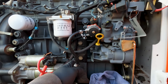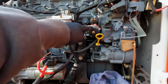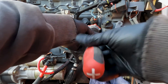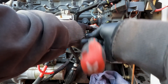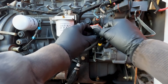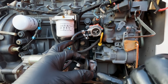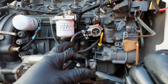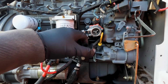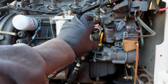If we follow this fuel line, you'll notice the fuel line coming from the primer bulb is coming straight from the tank through the primer bulb. The first place it goes is into our lift pump, and then out of the lift pump it comes around and into our fuel filter. In the center of this lift pump — or primer pump, whatever you want to call it — there's a little screw we can pop out. Right under this cap you'll notice a fine mesh screen. The fuel comes straight from the tank and has to pass through this screen first, so this is your first filter. Any trash or debris in the tank is going to clog this up before it ever gets to your fuel filter. So if you're having a fuel problem or fuel starvation, you change your fuel filter and you're still having problems — a lot of people start putting in electric pumps and never actually check this filter right here in the end of the lift pump itself.